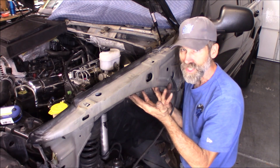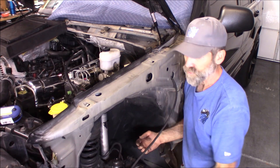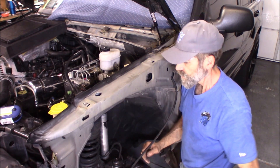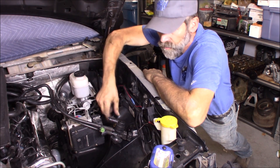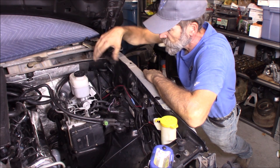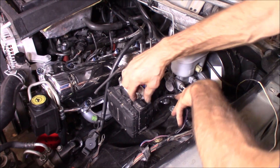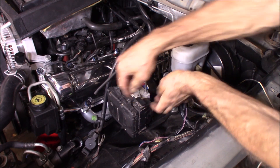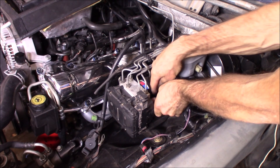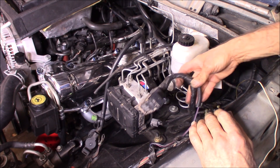What's nice about running the wires inside the channel is that they're very well protected. If a tire explodes and tears up the inner fender well, you're not going to damage any of the wiring because it's protected inside here. At this point I'm going to start disconnecting all the wiring — the ABS brake sensor, purge valve, etc. To remove the ABS brake connector you have to lift this part of the connector up and as you're lifting it, it will release. They can be a little stubborn — they get filled with dirt after all the years.